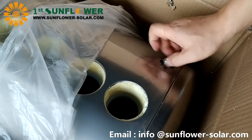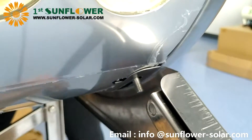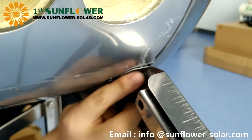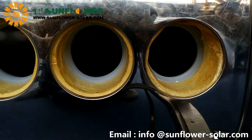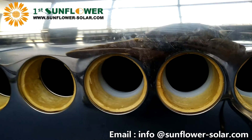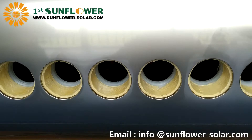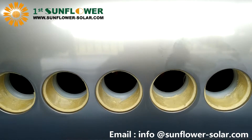After installation of brackets, we started to install the tank. First, remove the nut on the tank slide, then fix the tank to the bracket, align the slider screw with the hole of the tank, and screw the nut, but do not tighten it yet. After installation of the tank, check the seal rings inside the tank holes. If there is dirt on the seal, it should be cleaned up. If the seal is displaced and tilted, reposition the seal and fit it snugly against the hole of the inner tank.